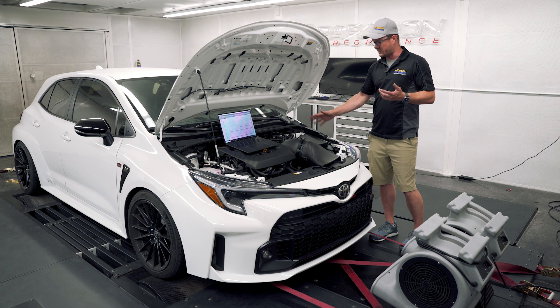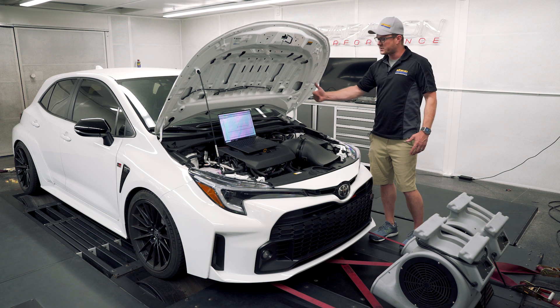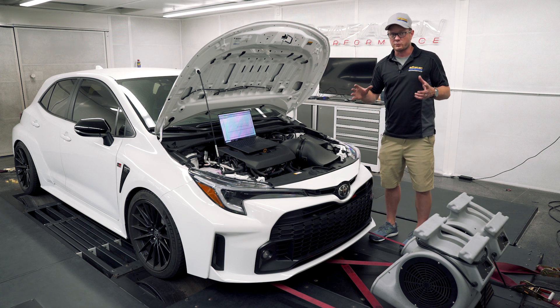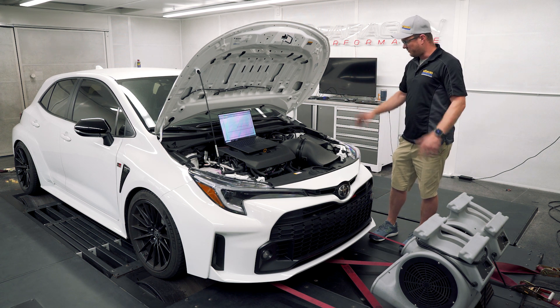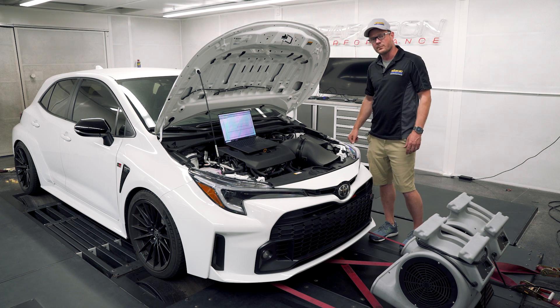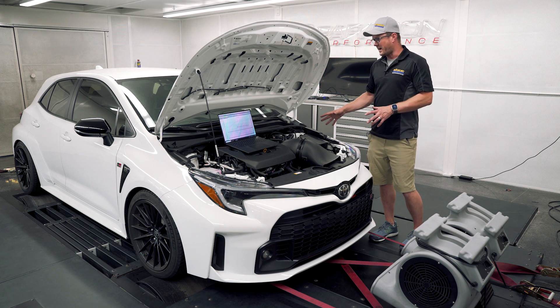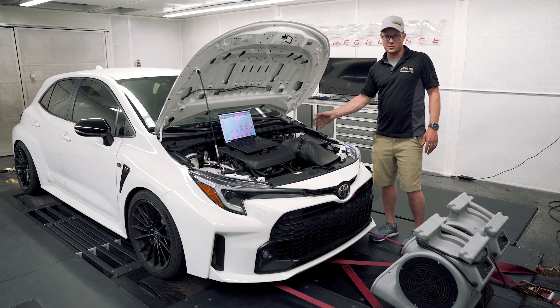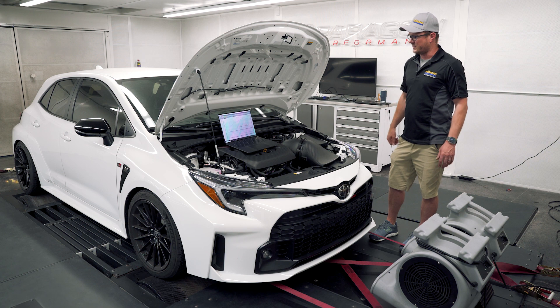All in all, I would say it's a very good intake. On the dyno compared to stock, my intake air temperatures are much lower — because of that flap and the hot air being pulled in, the stock setup actually hurts performance when intake temperatures are that high. The Eventuri is getting nice ambient air basically equal to room temperature at all times, which is impressive. I also mentioned the turbo inlet pressure — how much vacuum exists in the inlet — and I can see it is reduced, especially at low RPMs. Most of the way through the power band and all the way to redline there is a good reduction in inlet vacuum, meaning the turbocharger can get more air. All in all, fantastic intake — love the design, love where it's getting the air from, and it does make some nice extra power. As we tune these cars further, we can really utilize this intake to make even more power, but that's for another video.